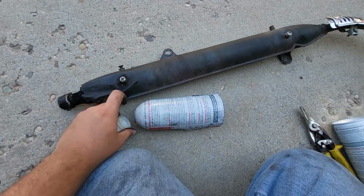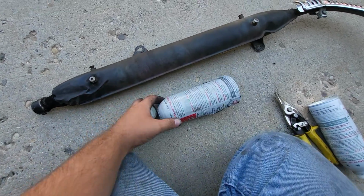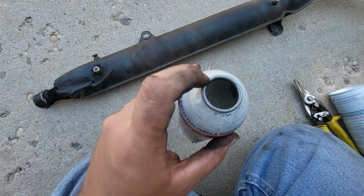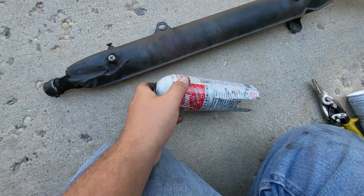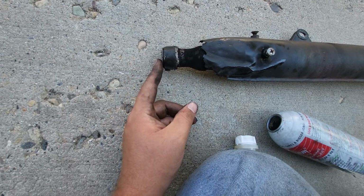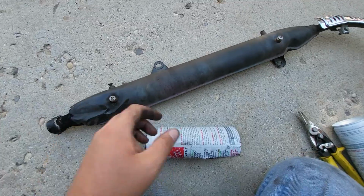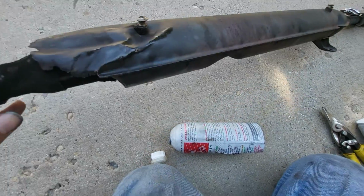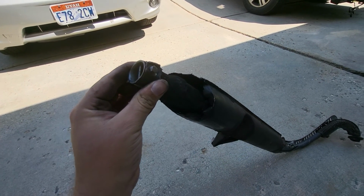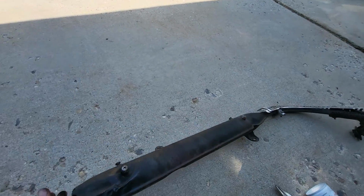Before you cut it open, it might actually be better if you do what I did. Basically, I just pried this, the cap assembly, off. It just goes on this metal lip, which happens to be the same diameter as the exhaust tip on a stock 110's exhaust. Now, to do this, you're going to be sacrificing the ability to remove your spark arrestor easily. But it's easy enough to replicate this, just make sure that you've cleaned out your spark arrestor good before you've done this, and put that bolt back in.